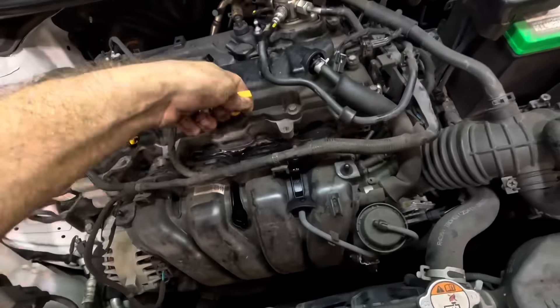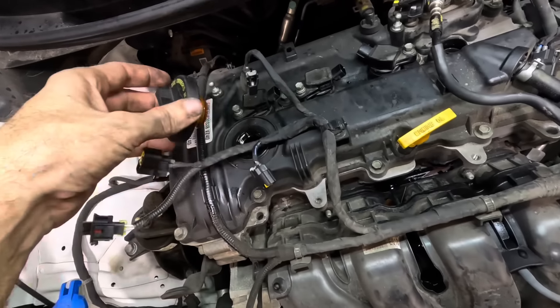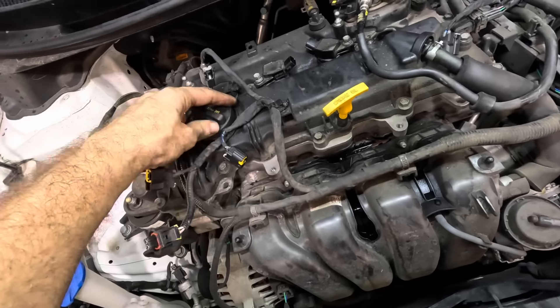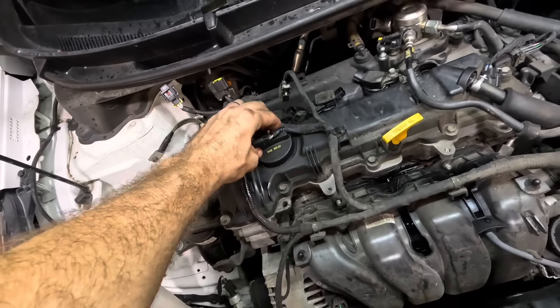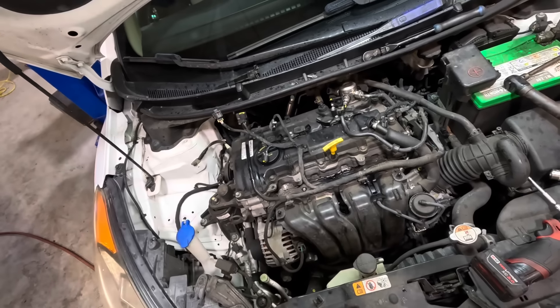We've also learned that this vehicle does not get a lot of mileage and its oil changes are infrequent. The oil was very far overdue on the change prior to the one I performed last year. I'm going to recommend that we attempt to de-sludge this engine — and if we find more sludge somewhere else, we can take steps to remove it. I think an oil flush would be in line at this point. Let's perform that and see what's going to happen.